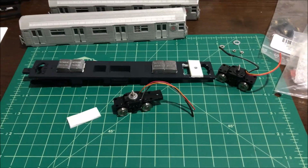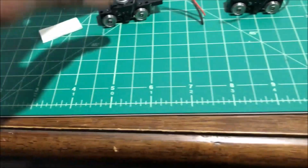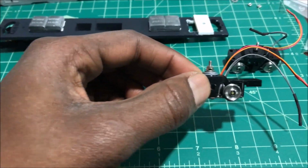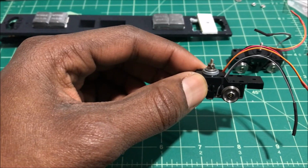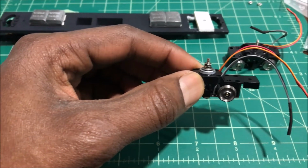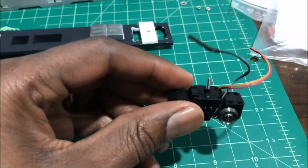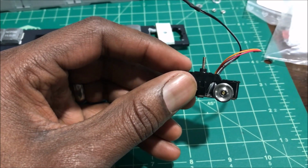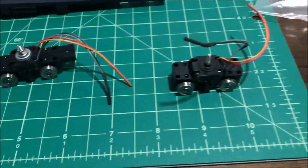All right, I took everything apart so we can take a look at what I did to make it work. Typically, the truck comes with all the mounting equipment. You see, it's got two standard nuts, not lock nuts, two metal washers, I believe they're steel, and one nylon washer. When you take everything off, ultimately, you'll have this. So that nylon washer sits right on top of that plastic extrusion where the threaded rod sits through.